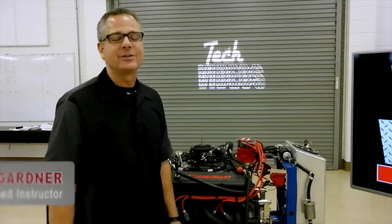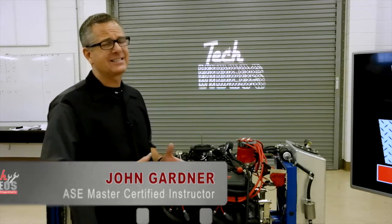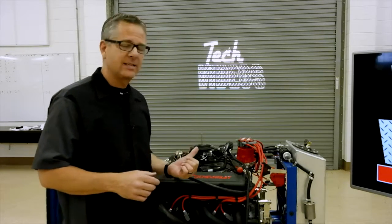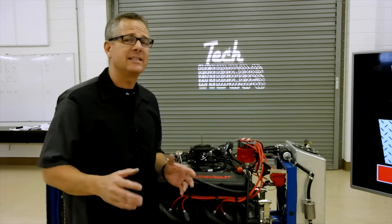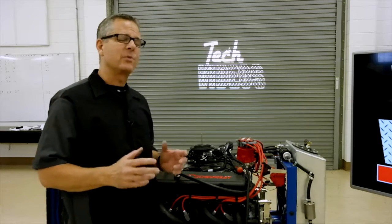When checking the mechanical integrity of your engine, there's a few tests you can run. You can run a power balance test and isolate the cylinder. We'll do a compression test today. In another video, we'll look at a cylinder leakage test so we can actually pinpoint what's going on inside. But this is pretty cool. It's called a compression test.